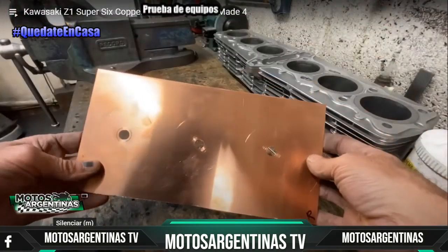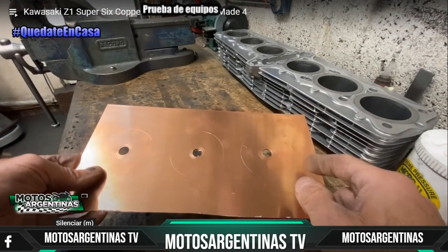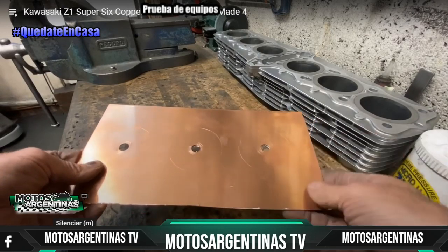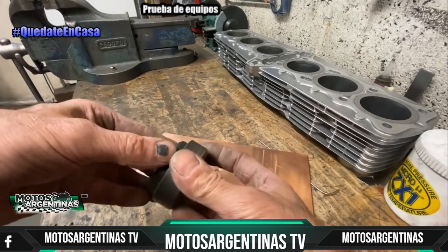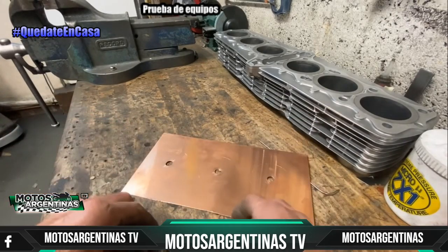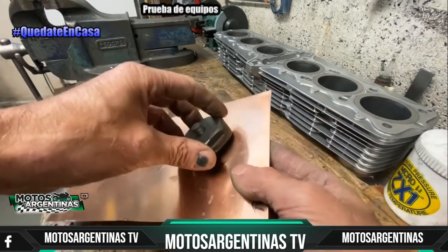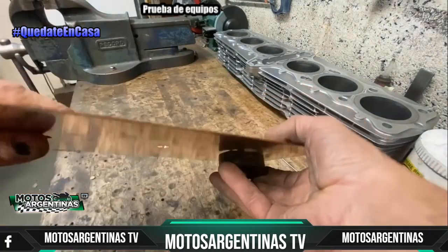With the 3 holes drilled in each piece, I will then be using my Qmax cutter to enlarge the hole to 52mm diameter. This is a Qmax cutter. These are designed for cutting holes in sheet metal. Normally you have a bolt through the centre and you clamp one piece each side, do the bolt up and it cuts the hole. When they get this big it can be very hard, so I decided to do it in my vise.